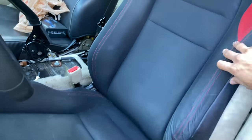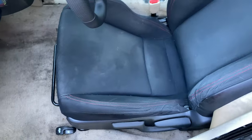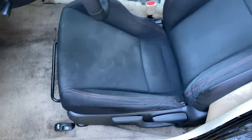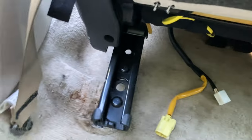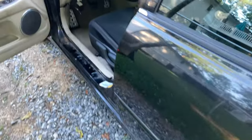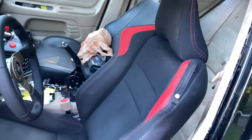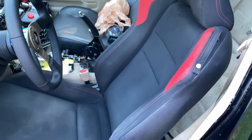Let me show you what's in the car right now. I really like these — the side bolstering is nice and tight and it feels pretty low. But the problem is these are the FRS brackets and they do not line up at all, so I only have one bolt in, which is a little sketchy. What's upsetting is these seats work so well — they even have the airbag plug. Overall I like them, but getting them to fit is just more work than I'd like.